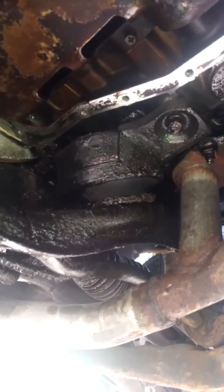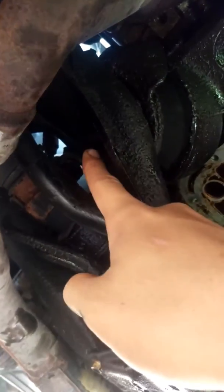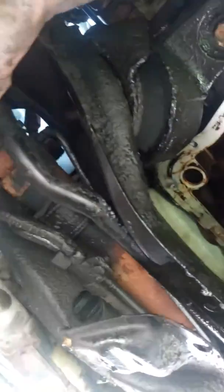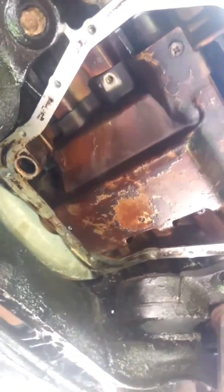Getting this out is kind of a pain. You have to come over here — see this big fat bushing right here and this set of threads? There's one on this side and one on the other side — those are the motor mounts, they're 14 millimeters. You're gonna need a mid-sized deep well. Sometimes you'll have an issue getting in between the exhaust, so you need to get them out and lift the motor to get these back four 10-millimeter bolts out. There's really no way around it — I lowered the crossmember and there's just no way to get past it.